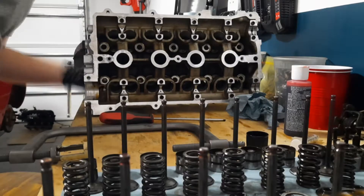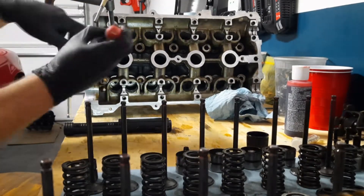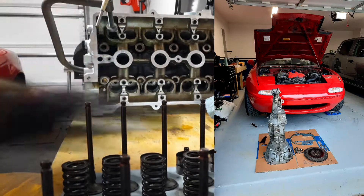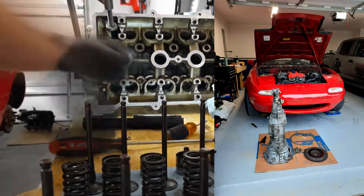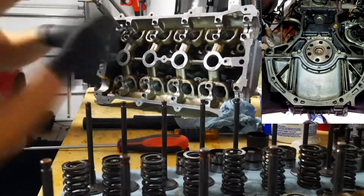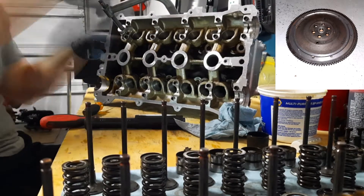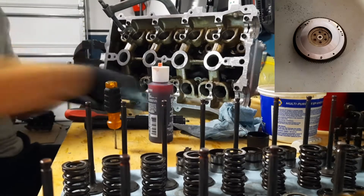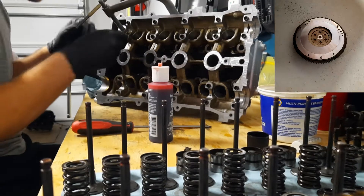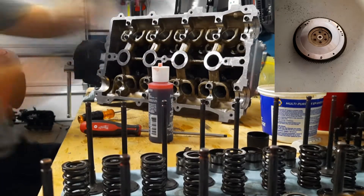That's going to look amazing on the new head. Here's the old head — junk. Rather than put background music on, I figured I'd do some commentary and show pictures of work I did right before I trashed the head. New rear main seal, cleaned up the back of the engine. For the flywheel, I had the machine shop shave off the initial inertia weight ring — it saved about three pounds, so good enough for me.